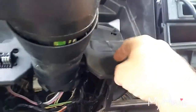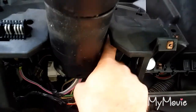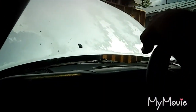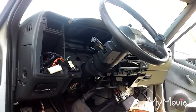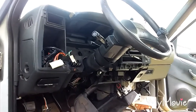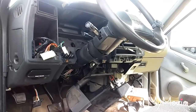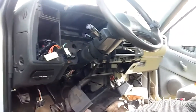You can see right here where this one's been busted before when we were doing this the first time. With a little bit of looking and pulling on it, you feel it's right here - the screw that you just cannot get to with the steering column in the way. So just unbolt it, drop it down, and you're ready to go. Then all that's left is a screw here, a screw over there, two up on top on the vent area, and she's ready to go. Non-stop it probably would have taken me 10-15 minutes to get the whole dash off.